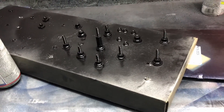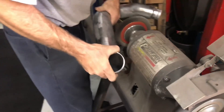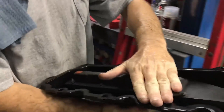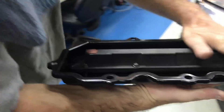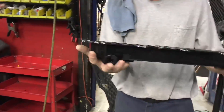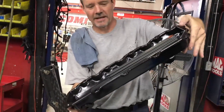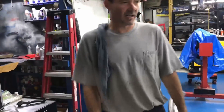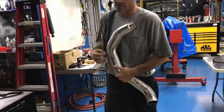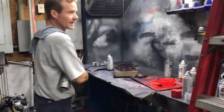Sometimes it depends which one of us is painting. I didn't do it, but then again I don't overwhelm it with paint. If you paint it on too thick you can always touch it back up with the little end of the grinder. The mating surface is just about dry now — I still don't want to set it on there yet. Prop it up so the crankcase breather box can drain — prop it in the bed of the truck at a little angle. That way the crankcase breather can drain properly.